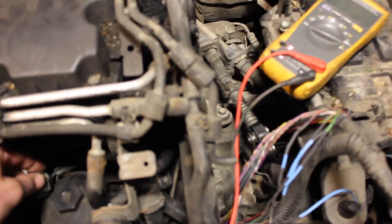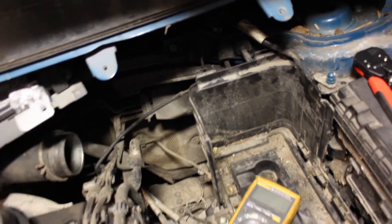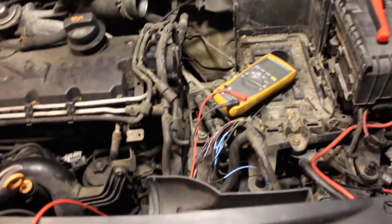you can look at the three wire colors: we have a green with a brown stripe, green with a purple stripe, and black with a white stripe. Find the same three wires on your ECU plug and test continuity. In this case, we didn't have continuity on one of the wires.